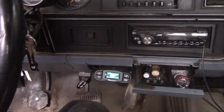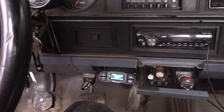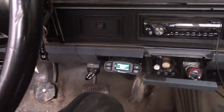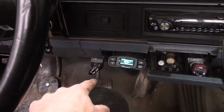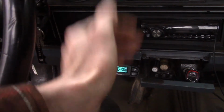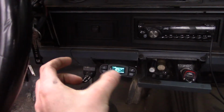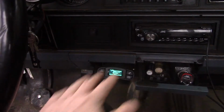to the trailer brakes. And there'd be other times I'd be fully loaded, going down a hill, trying to slow down to a stop sign or a stoplight, and I'd be leaning into that brake pedal, overheating my vehicle brakes, and the Hayes controller wasn't doing a single thing except putting out the minimal boost output to the trailer brakes, which is horribly, horribly unsafe.